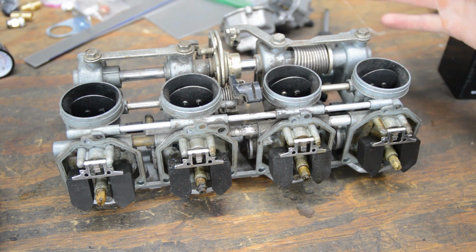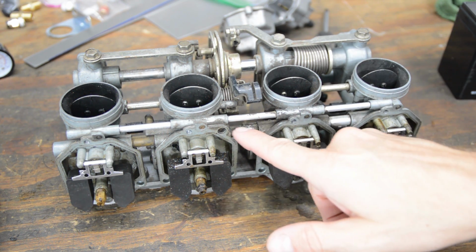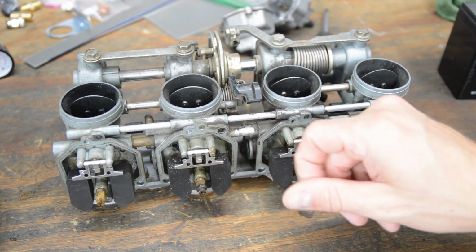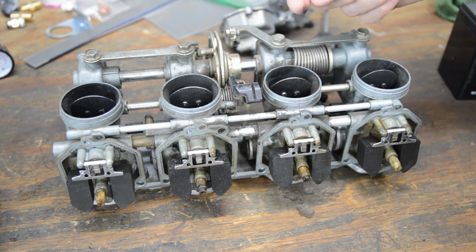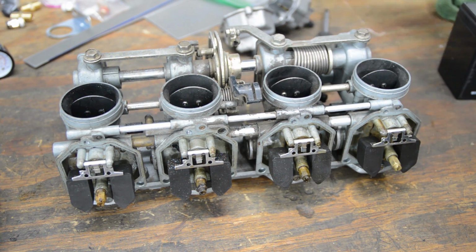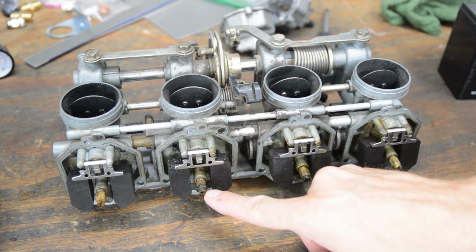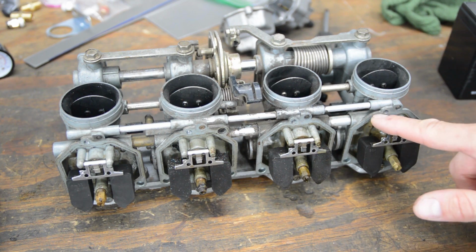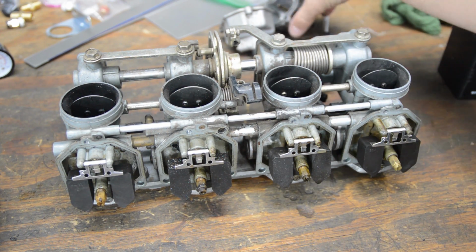So I'll let me calculate how much we need and go from there. All right, let's get a good look at the carburetors. These aren't too bad, actually. There's definitely greasy residue, so the ultrasonic will take care of that, no problem. In here, it seems like there's that gunk from just running it. There's a little bit of varnish on here, so we'll see how that does against the varnish. Varnish is hard to remove. It's sticky, icky stuff, and I can just smell it, man.